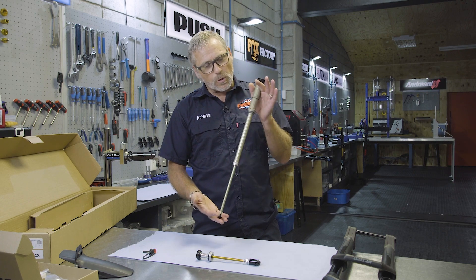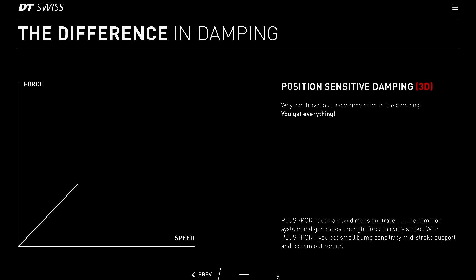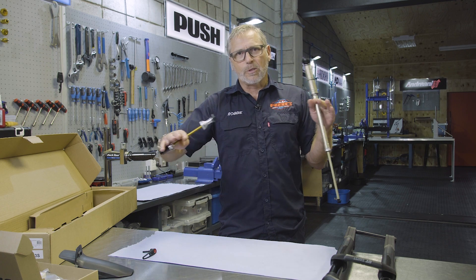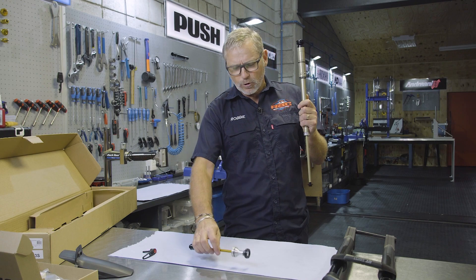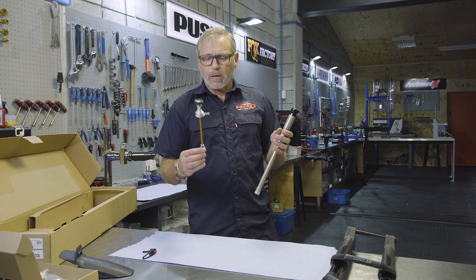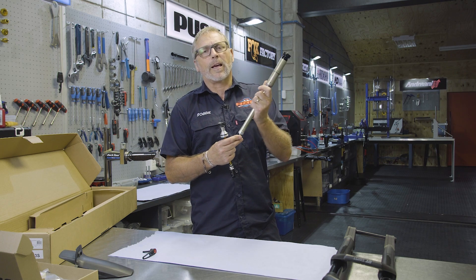The technology in this damper is called the plush port — it's a three-stage damping system. For the first stage, small bump damping, there's very little compression to pair with the coil, so that first bit of damping is really smooth and supple. Small bumps — little roots, little stones, stutter bumps — are handled absolutely amazingly. The mid-range is very supportive and you've got complete bottom-out control at the end of the travel. Combined with the coil pair, it's a super supple, sensitive system that handles big hits and small bumps equally well.